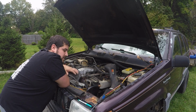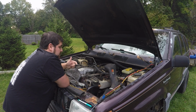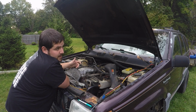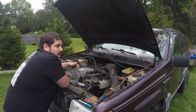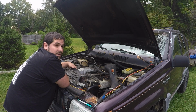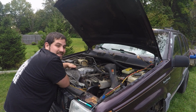Like I said, I run the electrical fan upgrade, and we'll go through that video next or sometime soon. I don't think it's worth it. Some people say you lose power with these HD clutches and you gain power with electrical fans. Yes, I did see a little bit of horsepower from when I took out my mech fan, but I didn't see anything really hinder me too much when I put the heavy duty mech fan clutch on. I do sound like a school bus going down the road, I'll say that much. These things are noisy, so prepare for that, but they're worth it 100%.